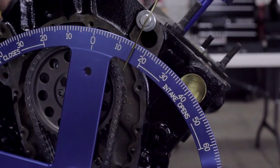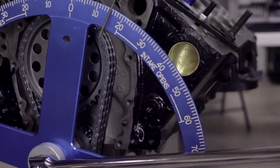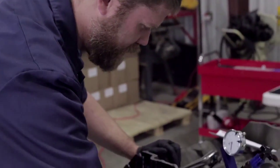We'll roll it around to the other side just till it makes contact with our plate - it looks like we're at fifteen and a half on the other side as well. So if we take those two numbers, add them together, and divide by two, we're right back to zero. We've got a good top dead center marking, so now that we know where it's going to be set, we can go back out.